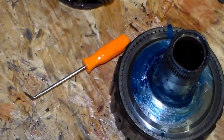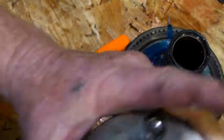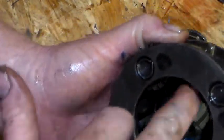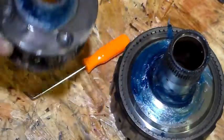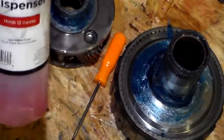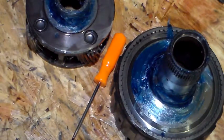That one's gooed up pretty good. And you do the same thing with the four-gear front planet. I'm going to get this outer race, or this shaft, greased up. Check everything in here — you've got a little gear, a bearing in here. You want to spray that with some transmission fluid. Use a ketchup bottle — those little squeeze ketchup bottles you can get at any restaurant or Dollar General for about a buck. That always works well for getting fluid into tight spots.